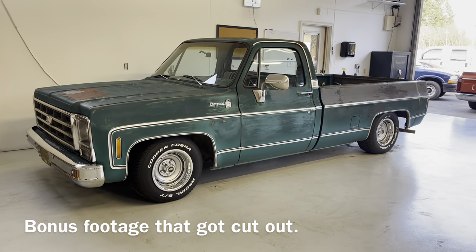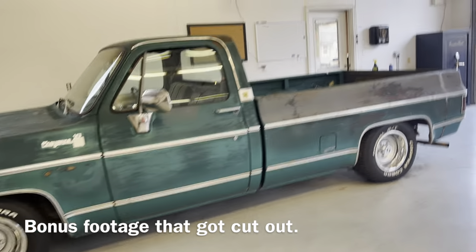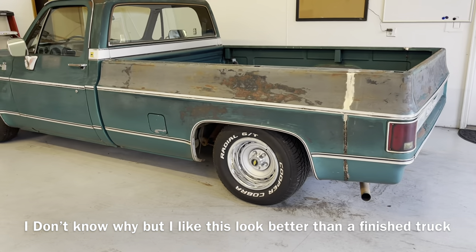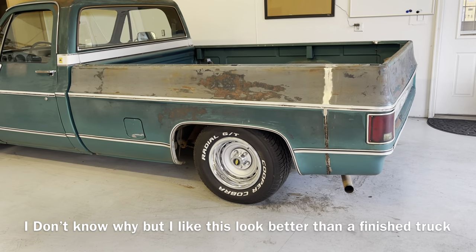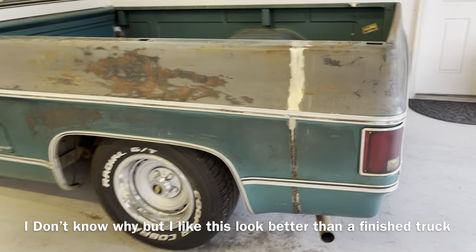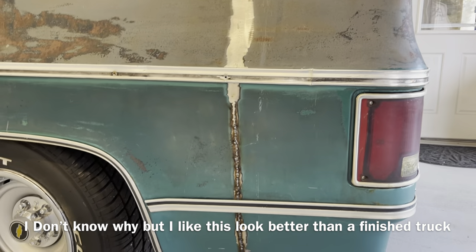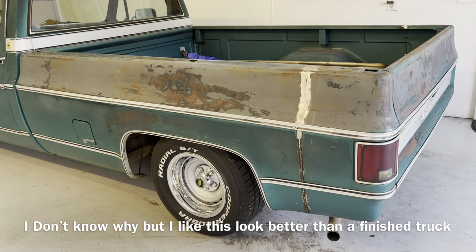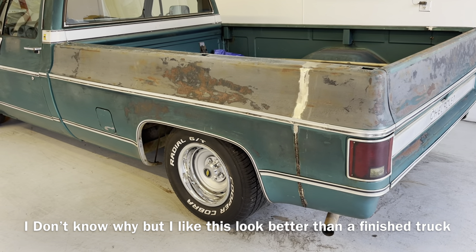Here she is. We're only taking six inches out of the back, and then we're going to take 14 inches out of the front — just wanted to show you what we've got done so far. Got the rear where we took six inches out, got it welded back together. Just stuck the moldings on there briefly to show you what it looked like. Got a new bumper here but waiting on the brackets. You can see here where we welded her together — I think it came out really pretty doggone good. No real warping to speak of, pretty clean. We'll probably do some patina paint on the top there just to blend that gray in and cover it up a little so it blends in more.